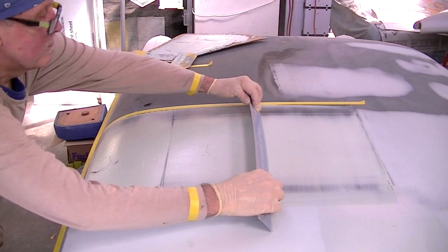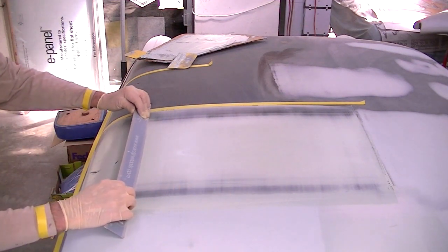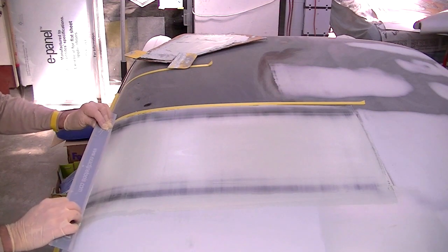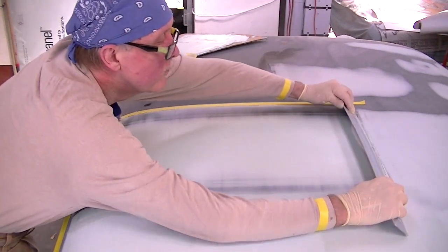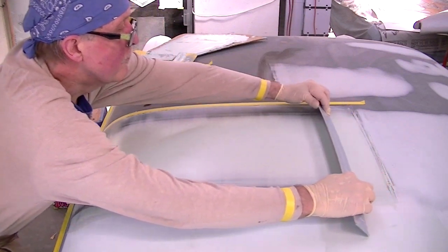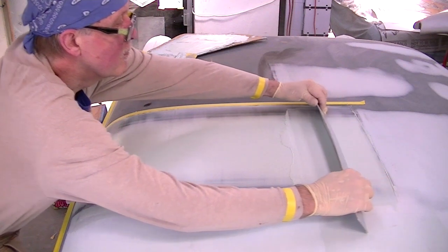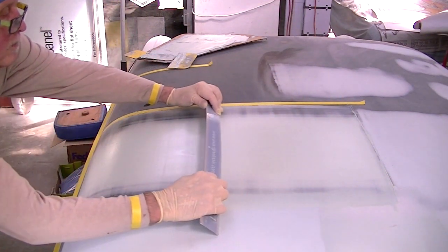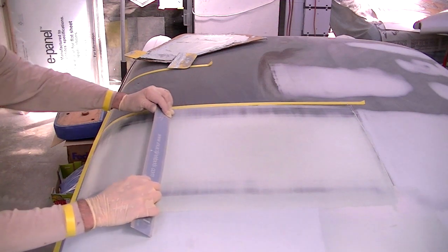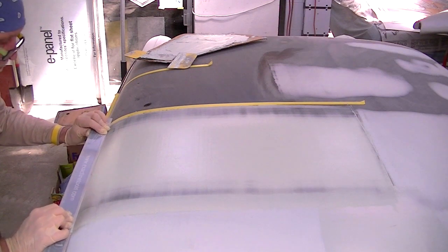I'm taking that sweep all the way up to the other side where I've already done a previous sweep and blending it on the other side closest to the camera that I've already completed my sweep. You can do this in a patchwork type process until you have completed filling all of the areas and all the dents that you have grouped by pencil or by tape line.